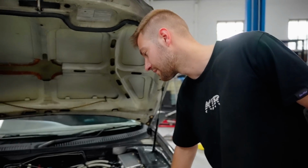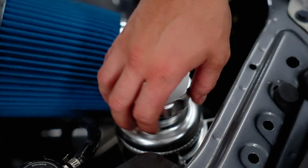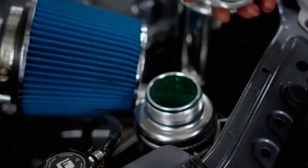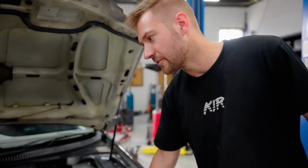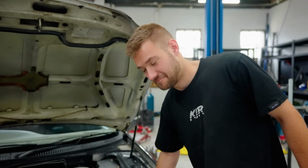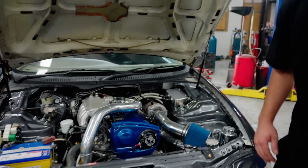We're back. Coolant temps are actually really good. The second fan's set to come on at 85 degrees and the car doesn't see over 85 degrees. AU thermos, baby. And of course the Phoenix radiator.